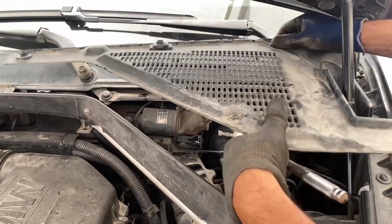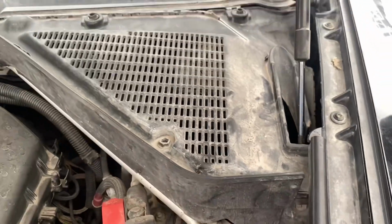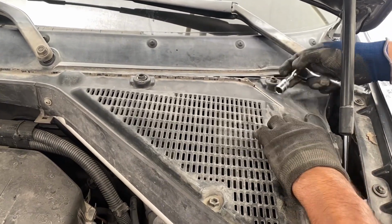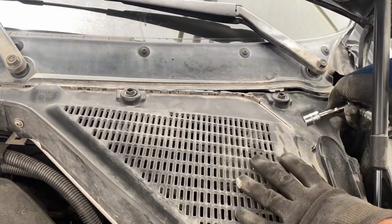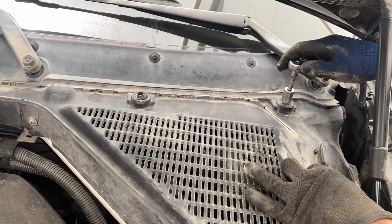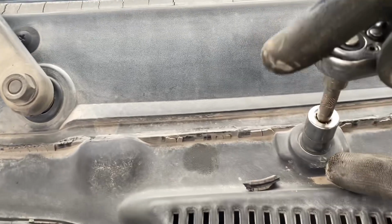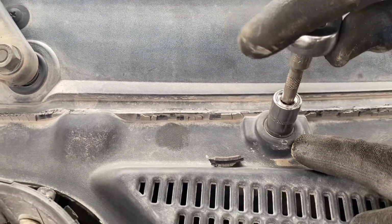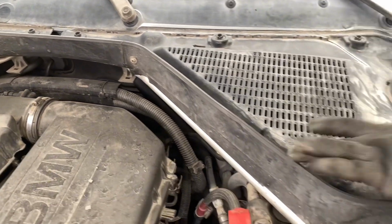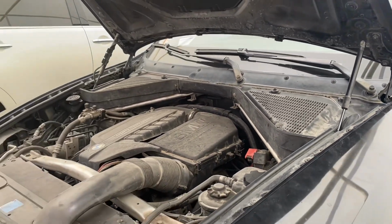Whenever you're feeling that your brake pedal is just going down or getting depressed to its bottom position, whenever you brake or keep your brake pressed for a while, if it is going to the bottom, then you have to check your fluid. Make sure there is no air in the line. So for checking that, you need to do this procedure so that you drain out all the air from the line, and the fluid has to be renewed.